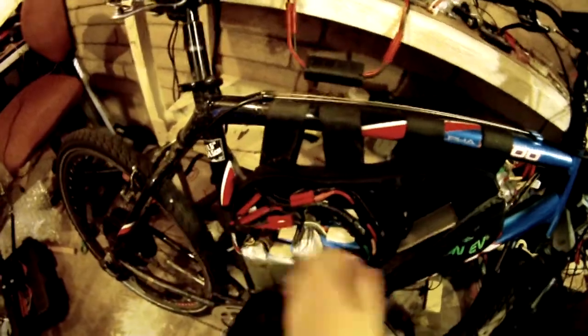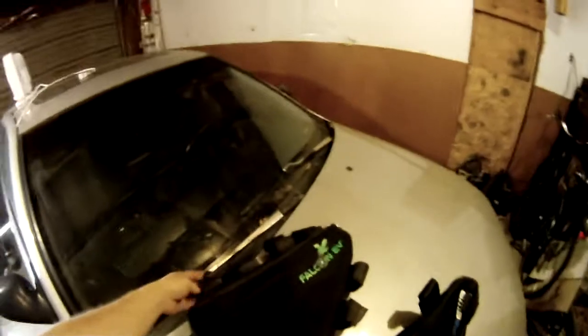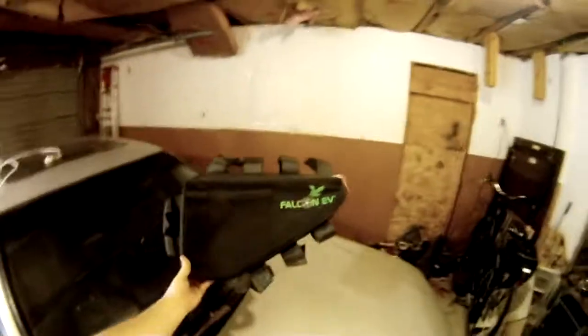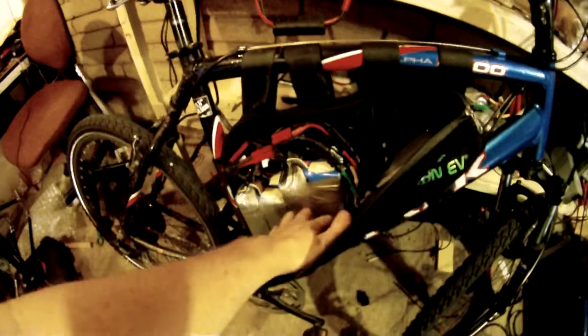These frame bags go on practically every bike — effectively you just adjust the velcro straps to your bike and stick it on. You can fit quite a lot of battery in these things. I've fit eight LiPo packs here and have fit about 16 in the past — that's 40 amp hours of battery at 36 volts. Do you really need more than that? Your butt's probably going to tire out before your battery does, so it's completely adequate unless you have some crazy 40 mile per hour setup.